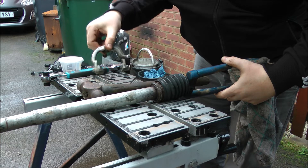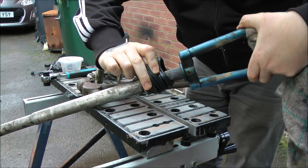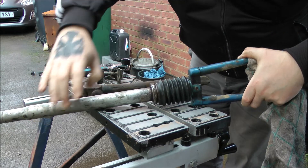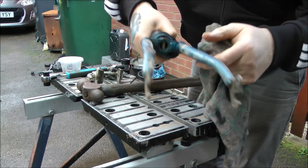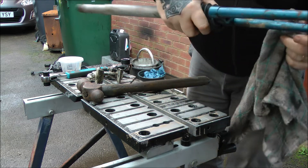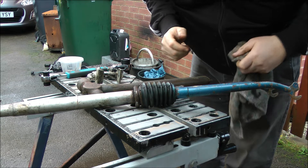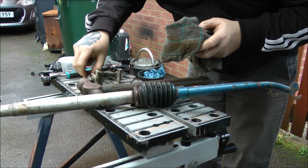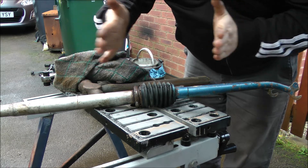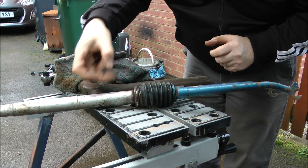The front caliper's off, ready to go in the box of bits. If I lift up this boot you should be able to see the splines there that keep the fork pointing the same way as the steerer tube. There is an aluminium tube in there that needs to be drifted out while preventing the spring from coming out and getting it in the eye. The spring is apparently a piece of rubber with a coil around it — that provides the damping and the spring keeps it in the right azimuth, stopping it binding from the steerer tube.